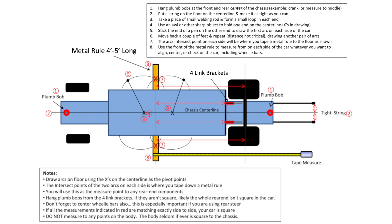On the rear, extend the string past your wheelie bars if you're running wheelie bars — we'll talk more about that in a minute. Get the string good and tight, lay it down on those two center marks, and tape the string down to the floor to secure it.